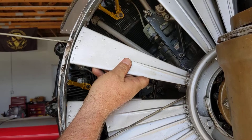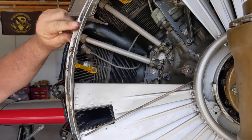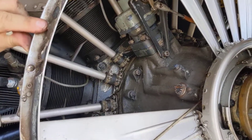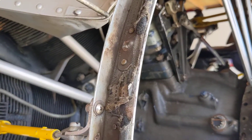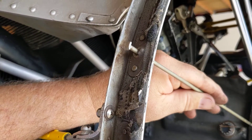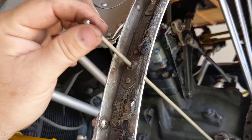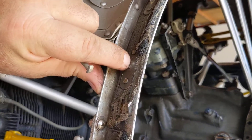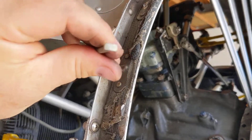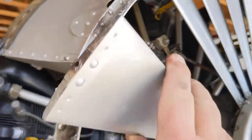So hold the gill in place. One note: on the outside here on this nut plate, these holes get worn out and the T on the rod wobbles in place. So I have taken my grinder and notched them a little bit further so that this T will ride in a groove and it won't allow the rod to wobble in place.